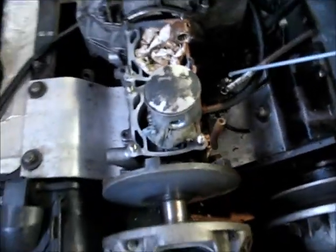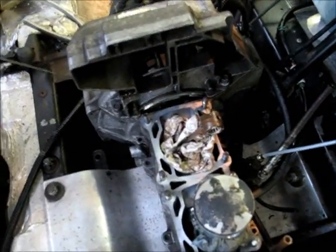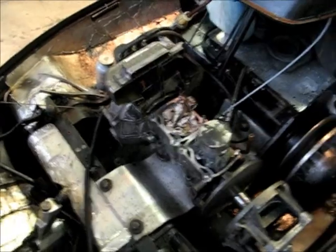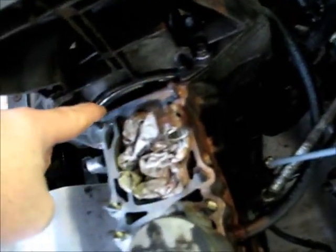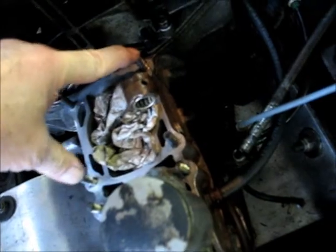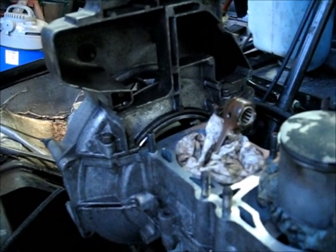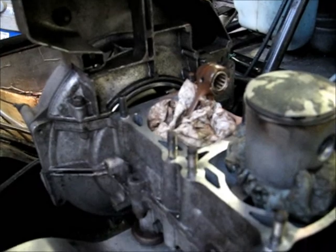That was a stock piston on that side. Anyway, I brought it home and I thought I had a 440 engine I could put on it, but I thought let me take a look at it first. When I took it apart and pulled the heads off — all the shroud and everything — the cylinder was there, and there are four studs that hold it down. Well, these two were twisted off and these two had no nuts on them whatsoever. So as a result you don't get a whole lot of compression — that jug was just sitting on there with nothing.